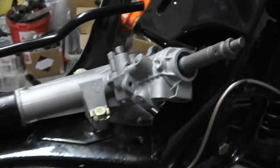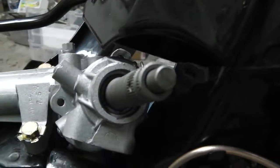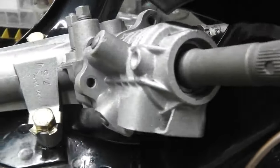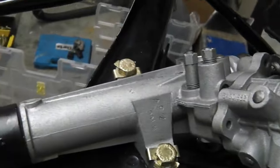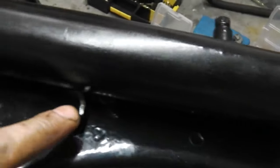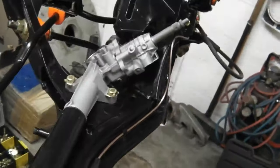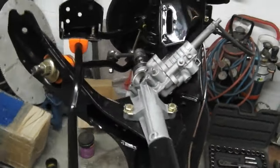Okay, and obviously I've got power assisted steering as opposed to the smaller rack that you'd have here, so there'll be differences there. You can see how it fits. Told you about the scallop out here and a little bit there to get that tube to lie flat, but it's not bad. Only a minor mod for that. It's pretty good.